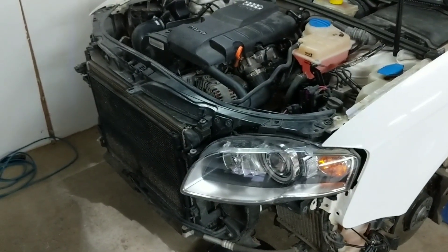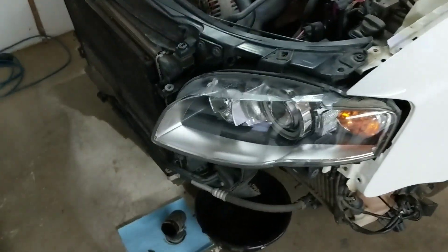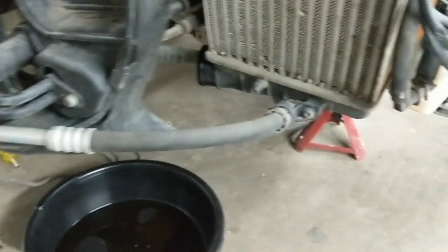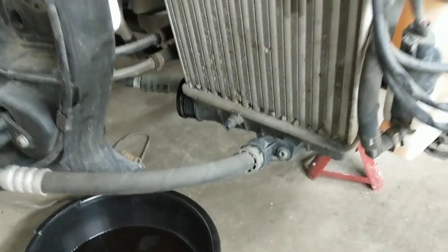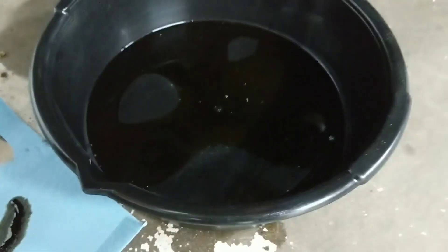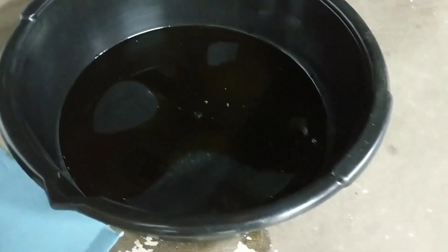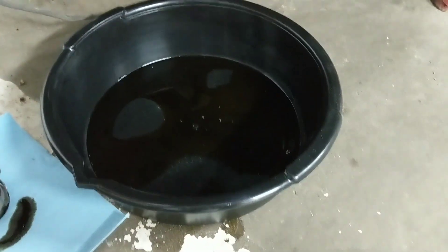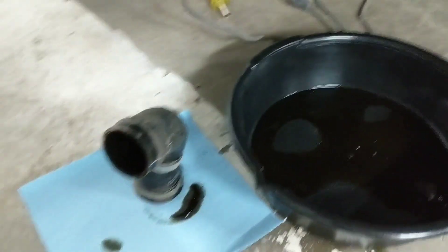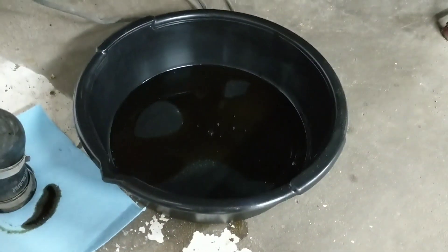I've been moving on and the front lock carrier is in Audi's service position. To get a little more space and pull things out further, I decided to take off the bottom side mount intercooler piping. The first one that came off gave me a nice bucket of oil, so now I have to figure out what might be going on there. I know my PCV system is fine, but maybe that's a sign of something worse. Hopefully not. We'll see.